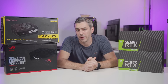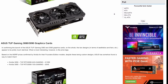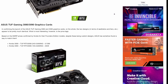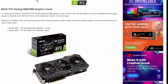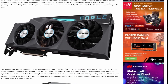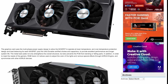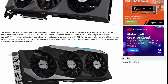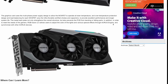So what does it mean if you're not buying a Founders Edition card? Well, frankly, nothing really changes. From the looks of things, we've seen a lot of custom AIB cards coming out from the likes of MSI, ASUS, Gigabyte, Palit, and many more, and it seems like they're actually opting to go with the existing connector. That's probably because they aren't going to be using the reference PCB design — instead, they're going for something much beefier, much chunkier, and consequently with a larger cooler. So they're opting to go with the existing 8-and-6, 8-and-8, or 6-and-6 configuration, depending on the model, instead of the new 12-pin connector we'll see on Founders Edition cards.